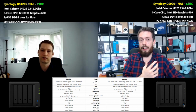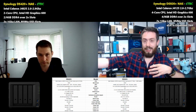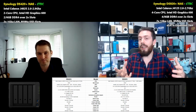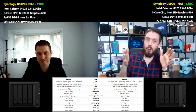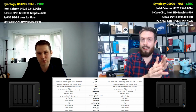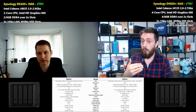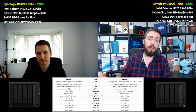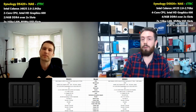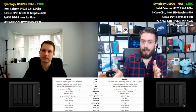Because of that, on balance, I would consider the 420, because it would make me wonder: I might be buying a new piece of hardware in 2 to 3 years down the line, and the existing 18 series has 1 GbE. So all of them feel like they've got a slightly shorter half-life. Therefore, the 420 might be a better long-term economical choice for many people jumping into NAS for the first time, because a lot of people upgrade a few years down the line if they start seeing they can really use all of these things, as you say yourself.